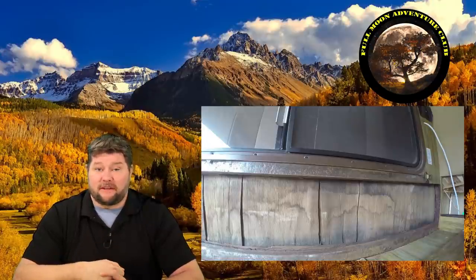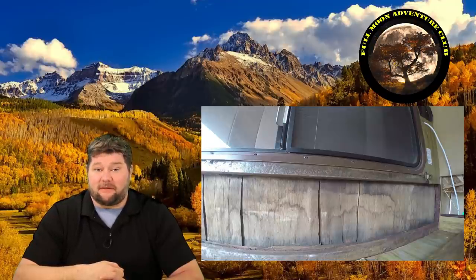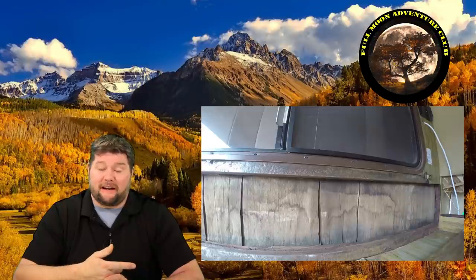I want to go over a couple of things — this is kind of for entertainment purposes only, because if you start tearing into your own RV, I cannot be held responsible for what you're going to find in there. If you have a wooden framed RV, water damage is really going to eat up that wooden frame super fast, and you need to make sure it's still structurally sound because that's what holds your RV together while you're driving at 70 to 80 miles an hour. In my case I have a steel frame that goes through the entire RV, which really saved me. It was heavily rusted but still very structurally sound, so I'm going to go over how I treated that and how I'm going to prevent further corrosion in the video.